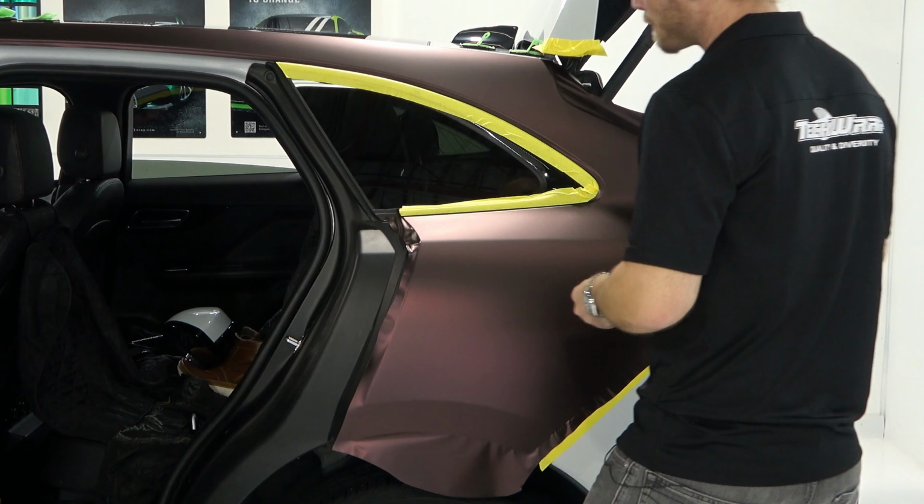That's pretty much it. I've wiped the panel down with 70% isopropyl alcohol. I have my piece cut, it's already over there. I'm gonna grab it, put it on top of the quarter panel, and we're gonna do this. One thing is, I can't use magnets. The quarter panel is not made out of steel, so my magnets don't work. Doors, on the other hand, were magnetic. Weird, right? Anyways, let's grab the piece and bring it over. I have it right here and show you how to do this.